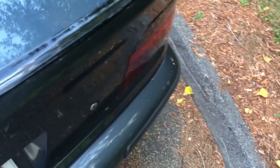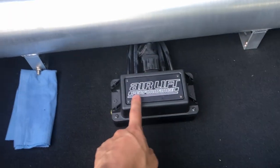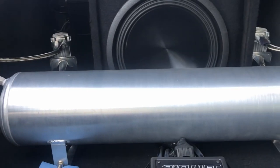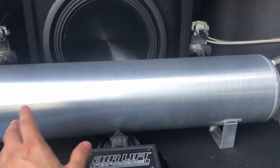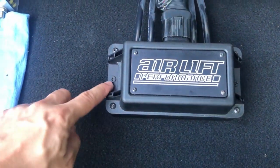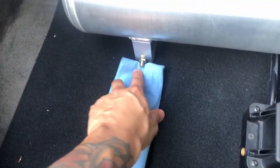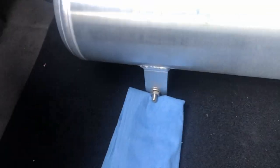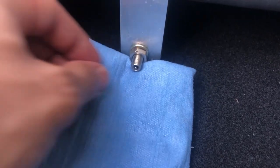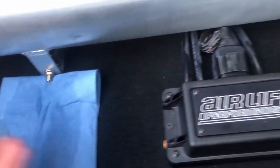If you haven't seen my setup, this is what it looks like — pretty simple. The manifold right here is what's no good. In order to take it out, you have to air out everything — the bags and the air in the tank — then take out all the lines, making sure to mark down which line goes where. Unplug the switch, remove this screw that holds it down, and it should just come right out. To drain the air, there's a little cap — unscrew it and press it like a tire gauge and the air comes out. Sometimes water comes out too, so that's how you drain the tank.